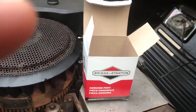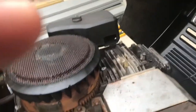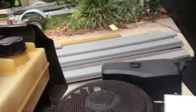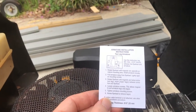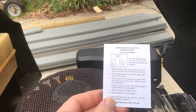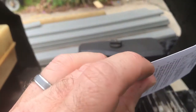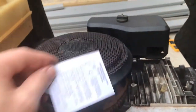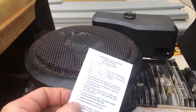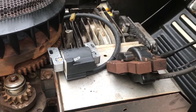I ordered a new coil and got a new spark plug boot and oil filter at the same time, so we'll do some basic service as we go. You also get a tool when you buy the coil — this card is actually your tool. You have to shim the coil to a certain distance from the flywheel, and the card gives you the correct gap distance. We're going to lay that in there and make sure it's the proper distance between the flywheel and the armature.